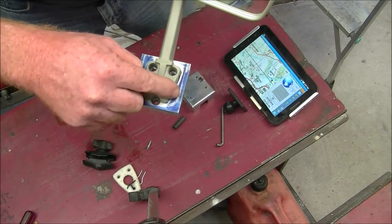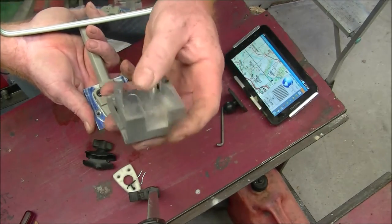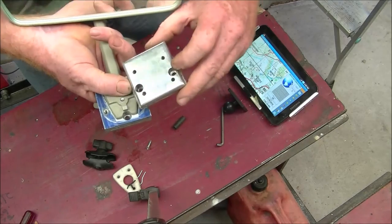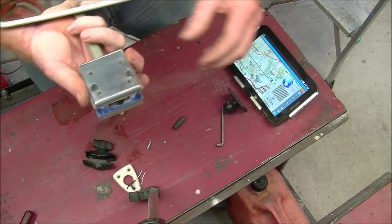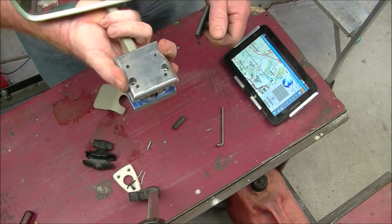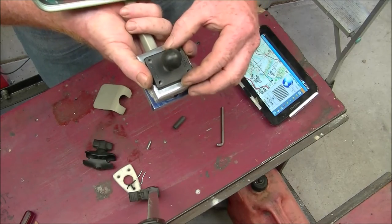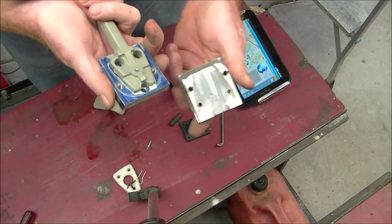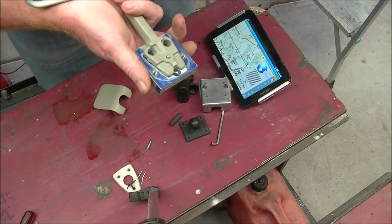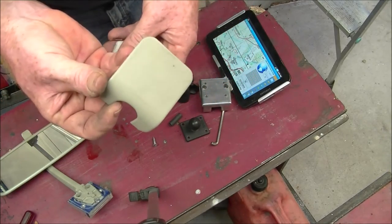That gives us two more holes that we can then tap in the second piece that we've got to mill up. You've got to make a cavity in there to cover that, and also leave space for the two bolt holes — those will end up being the two bolt holes — and that'll sit over like that with M6 allen key bolts fitted into place. That's the second piece that gets fitted to the car. Then you put four more M4 bolt holes in there, the RAM mount ball joint gets attached, and they get bolted into place. It's not hard to make and it looks good. If you ever get rid of the car you can remove all this, reinstall the original plastic bracket and cover, and it's all stock again.